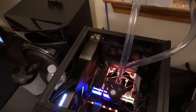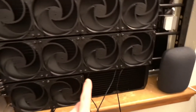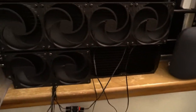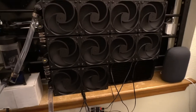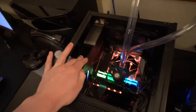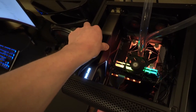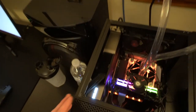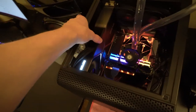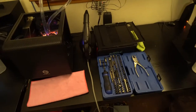The next video will probably be when I get the other two fans — I ordered another five-pack of Arctic P12s and I'm waiting for those to arrive so I can add the final two fans, giving a total of 12 fans across three 480mm rads. Then I'll add the Heat Killer block and the Corsair Hydro X series block for the 3080. I'll also do a video when I take the 3080 apart to put the block on — I don't know exactly what I'm doing, so it probably won't be the best video, but hopefully it'll be entertaining.